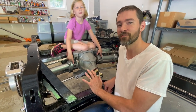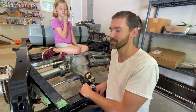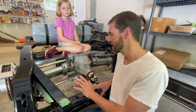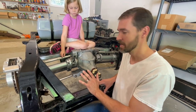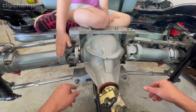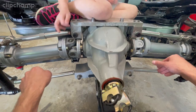This is an issue they actually had from the factory, which kind of blows my mind. I don't know if they knew this issue was going to happen or they just figured it out after the fact. The half shafts are basically built with U-joints, and the U-joints would get in a bind when the suspension is fully extended.